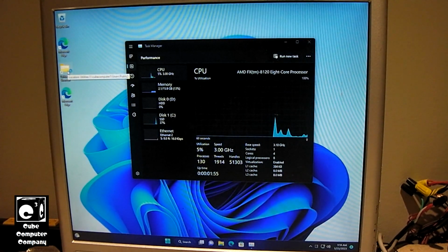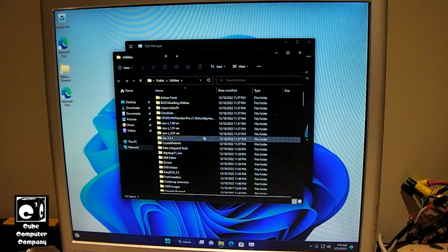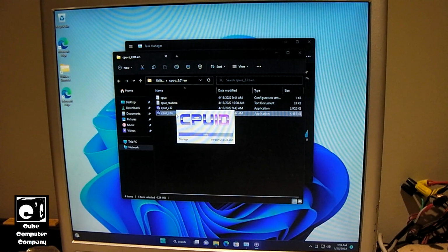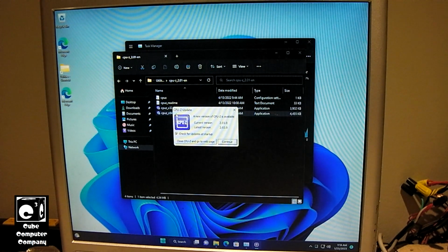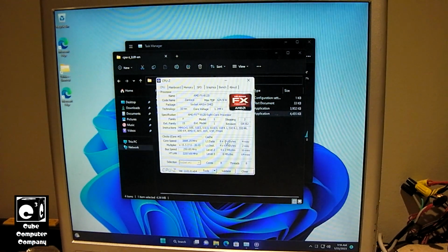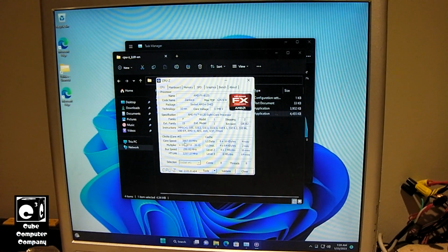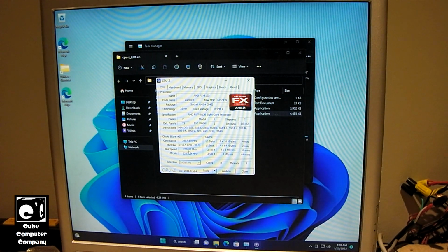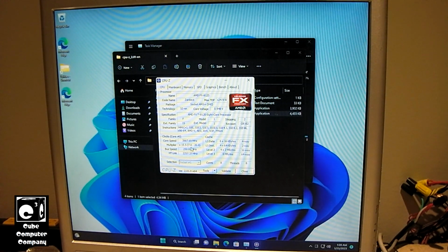but yeah, if I go pull up CPU-Z, you can see here it's showing almost 3.9 gigahertz, which was the overclock that was done earlier in the video. So yeah, this is like the automatic overclock setting that this motherboard has, and you can see it based the overclock off of the bus. And of course this is an unlocked CPU, so the processor could be overclocked by increasing the multiplier. Matter of fact, when this CPU was in the Metal Lux quite some time back, that's how I overclocked it. But isn't this weird?